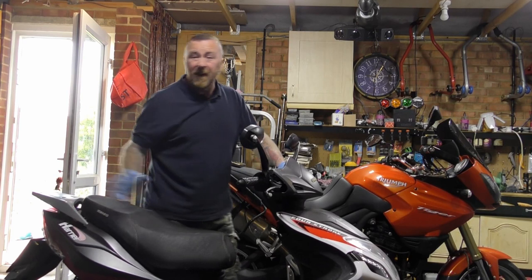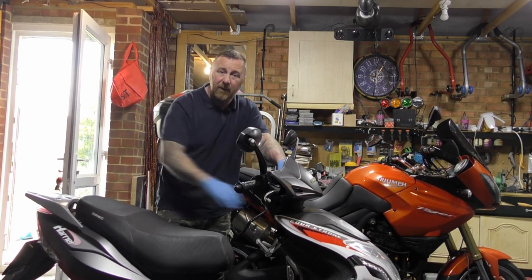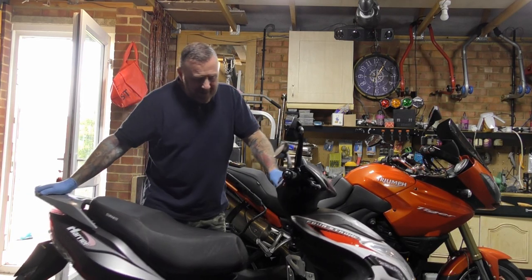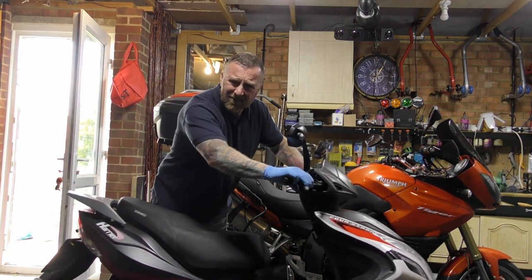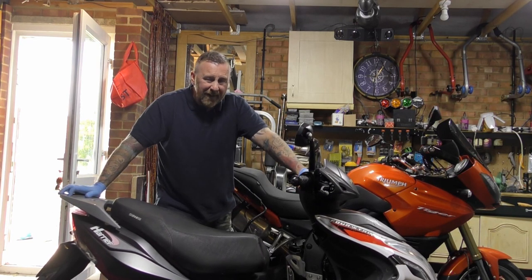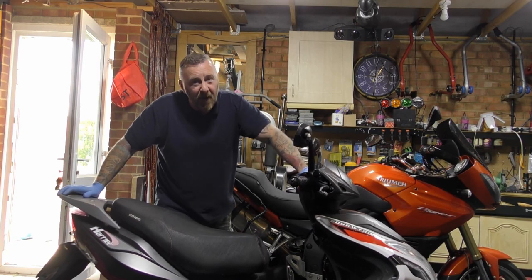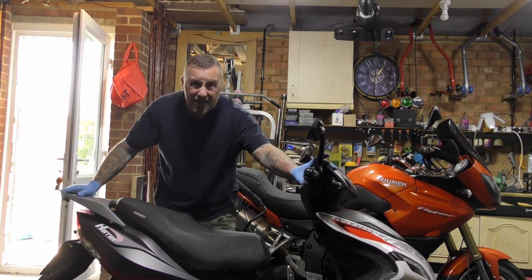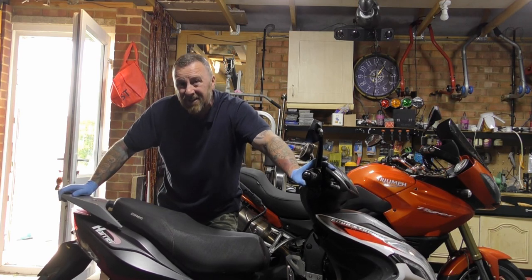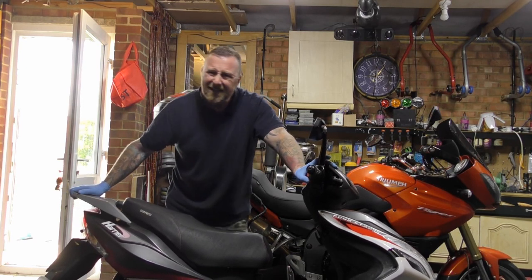Then you're talking about front suspension — that's gone too. A lot of places won't bother renewing just the fork seals because they're so cheap to buy as whole units, so you have to buy a whole new front end. That's money. Rear suspension — that's money too, and a lot of work. When he bought this, if he'd noticed that sound and checked it, he wouldn't have paid out the money. I know he paid out for the starter, and originally it wasn't starting well. He'd put a bolt across the solenoid to get it starting — that can blow the CDI. Please don't do that. Check out why first. If you press the switch and you get a click noise, that means the relay works — then it's down to the starter, but still intermittent could be a worrying problem.